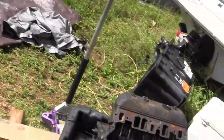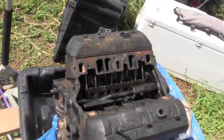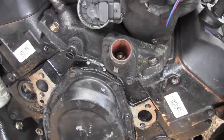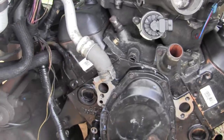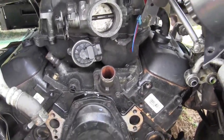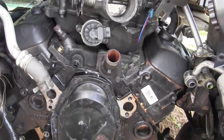I think it was the fact that number six was clogged up with oil that caused the number six bearing to spin and damaged the crankshaft. This does have a damaged crankshaft, but remanufacturers and machine shops know how to repair crankshafts — something called spray welding or whatever. Post a comment if you know, or give me a link to a video that shows how they remanufacture or recondition damaged crankshafts. They're too hard to make to throw them away.